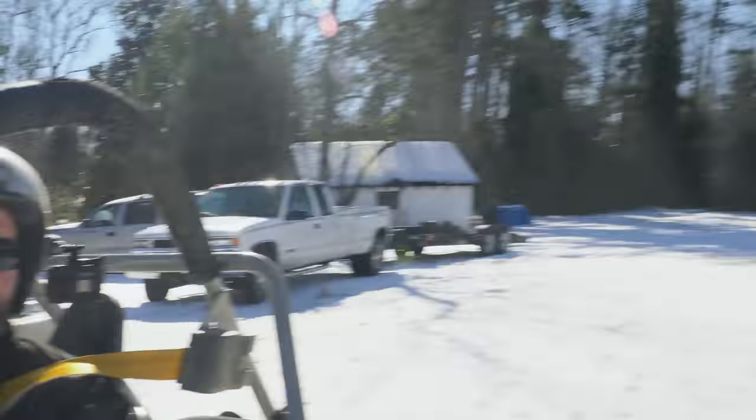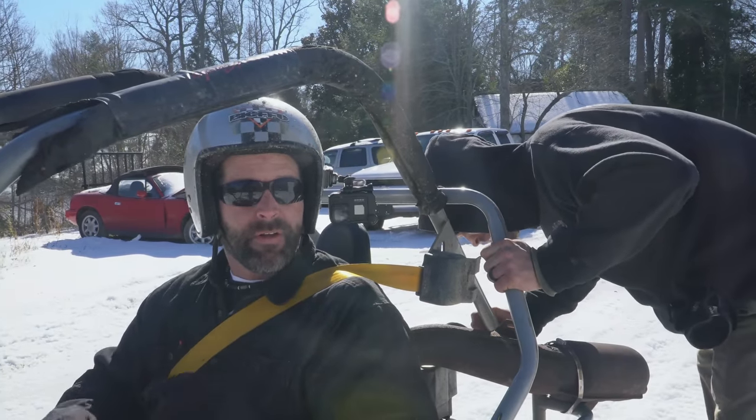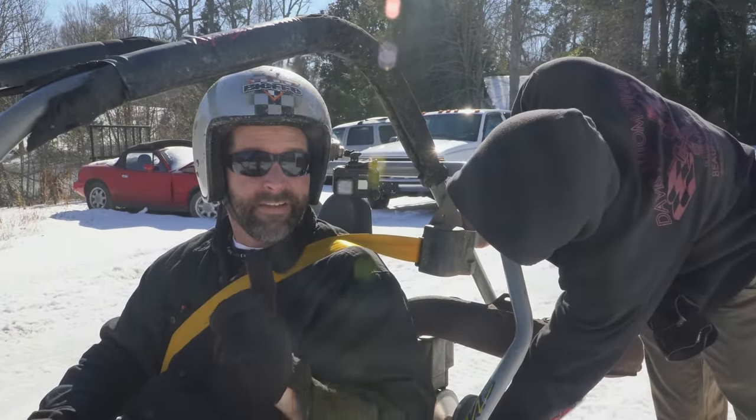Yeah, and that's a good speed for our track as well. So we do have some belt slip. My guess is maybe our gearing might be just a little bit too tall, or we've got a really old belt that might need replacing. Also, maybe the engagement is a little bit too soon. Maybe the weights in the drive pulley are a little bit too heavy. Maybe we can go with some lighter ones. Yeah, that won't be too bad. This thing's fast. I know we can get it better. It's already fast, and with a bunch of tuning, it could probably be way faster.